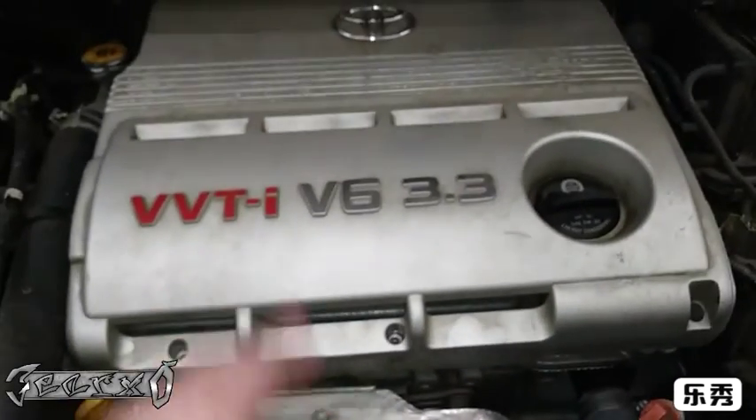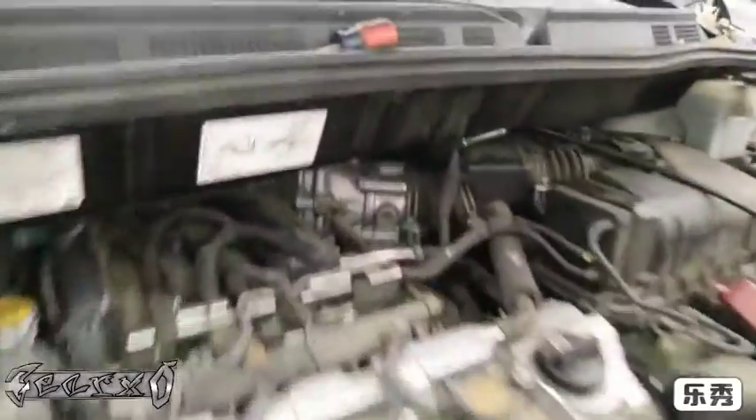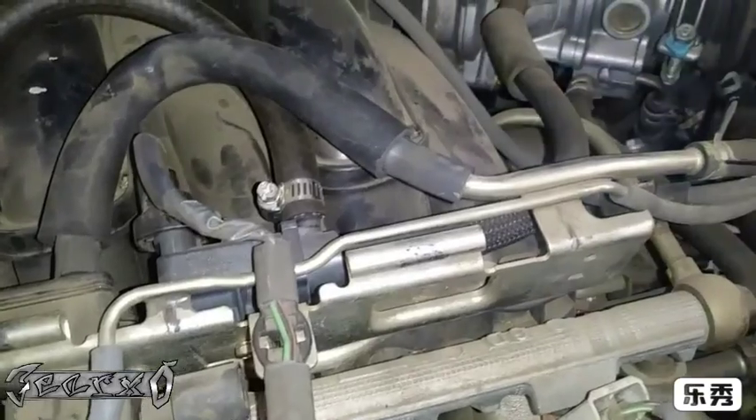Once that is clamped, we're going to take this engine cover off. There are three nuts right here that take a hex socket. After I got that off, I got my smoke machine ready to go. Put the smoke machine nozzle in the test port and as you can see, the smoke is running through.